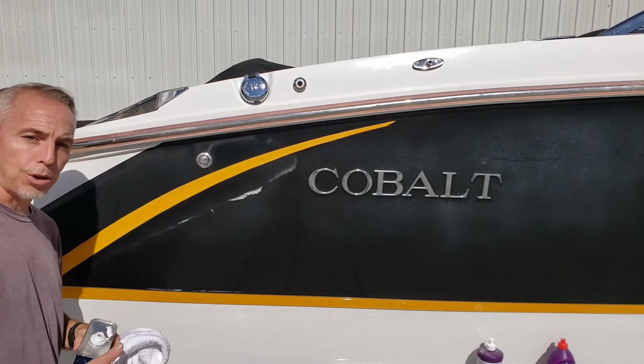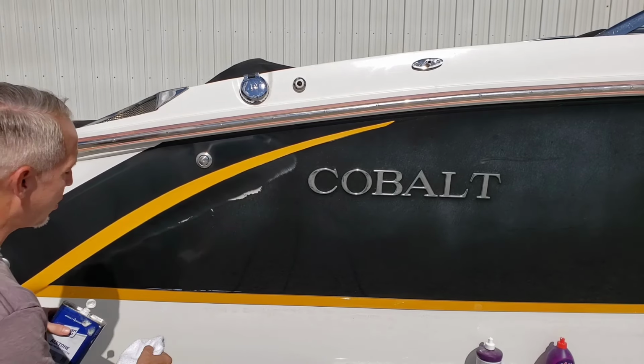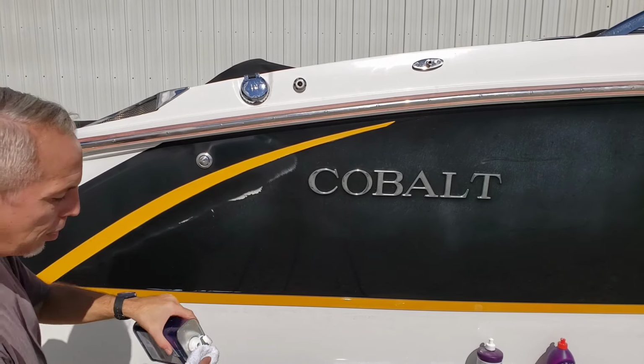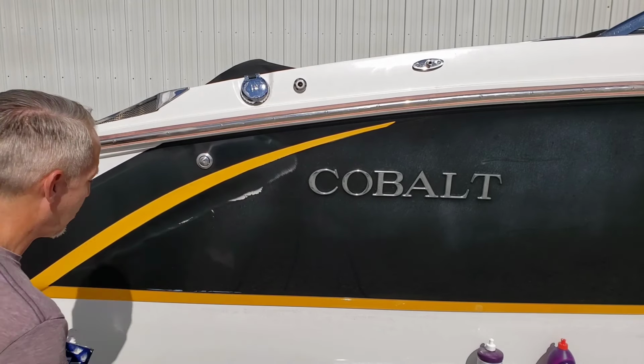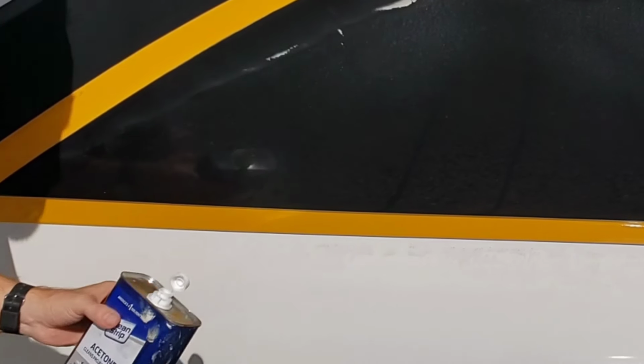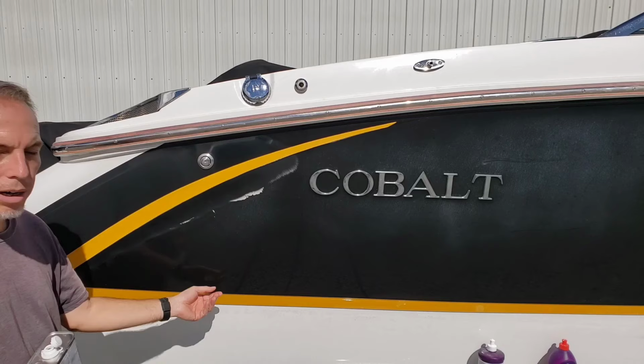But because this is YouTube, and I don't know how dumb you guys are, I'm going to suggest, if you've got a mark on the edge, take some acetone, put it on a rag, saturate a tip of the rag, and then run back, and oh my God, it's gone. It's a miracle. And I didn't risk pulling off a whole bunch of gel coat, having a white spot here on the side of your boat.